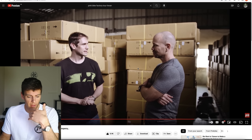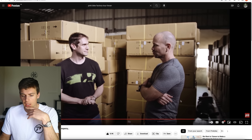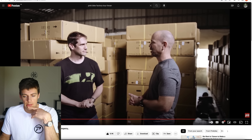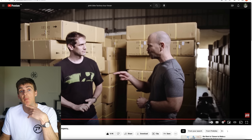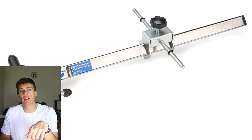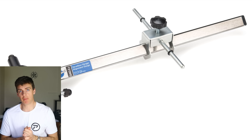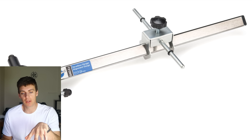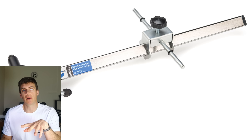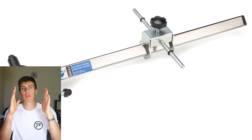Let's just remind ourselves of the bike industry we're dealing with. This is Pink Bike at one of the Pivot factories in Taiwan — one of the better ones — and that's an employee sleeping on the floor. Anyone who's worked in a bike shop will know this tool: a derailleur hanger alignment tool. This goes back to bike industry QC being turd — this tool saves the day. As we know, bike frame dropouts are not always perfectly parallel or straight, so setting the mech hanger alignment is crucial.